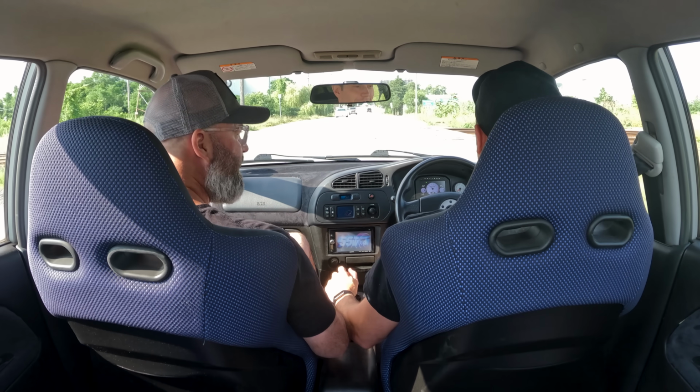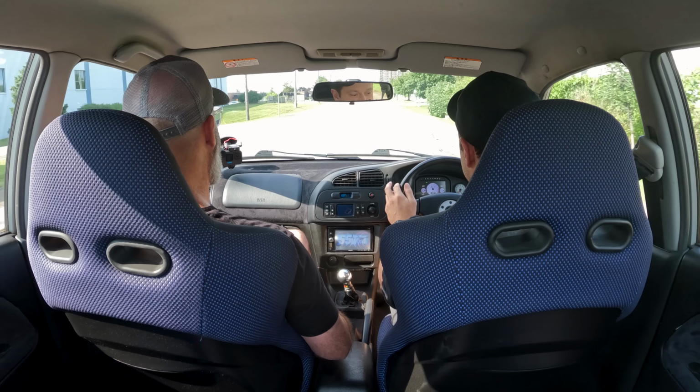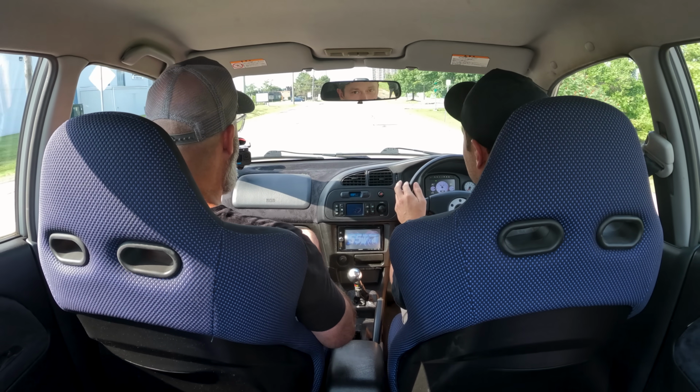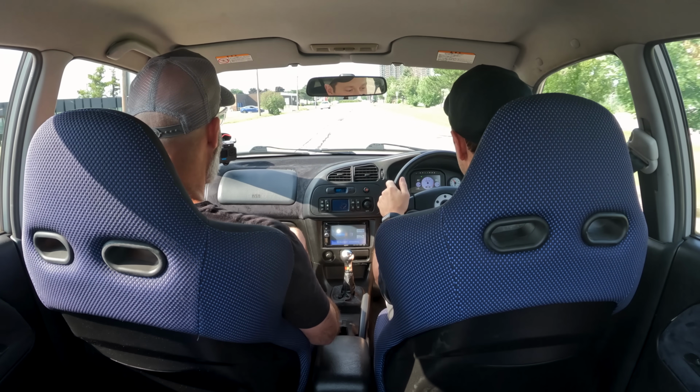I can't help myself. So if you think back to when we broke the original motor in, we used HP Academy's break-in procedure, which I think is a pretty standard fresh engine build procedure. Which is, just add load for about 10 seconds between say 2,000 and 4,000 RPM, and then take the load out for 30 seconds, then add load in for 10. Load it up. That's about 5 PSI.